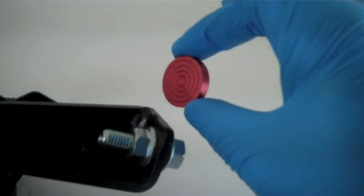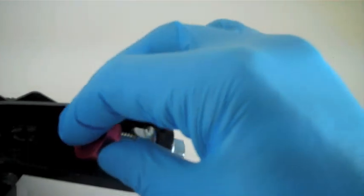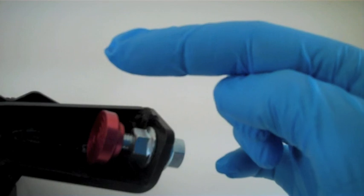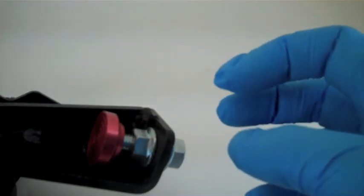Take the supplied cup, which will be pressed up against the master cylinder itself. This does not thread on — it seats on here and is held in by pressure, so be careful not to drop it or scratch it up.